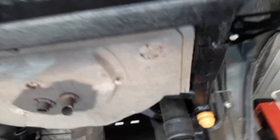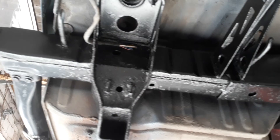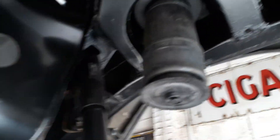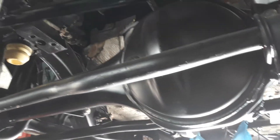The 50th - I've just put up a photo album of this but as you can see it's all coming on really nicely with quite descriptive pictures. New flexes throughout, new brackets, new shock absorbers, new suspension airbags, new bump stops. The chassis has been done all the way from the back, along the chassis, all the way up to the front - pretty much a complete job. New flexes again at the front, new calipers, discs, pads, shock absorbers, airbags. This axle the customer actually sourced from Italy because the front one was not in particularly good condition. New bump stoppers again on the front, so that's coming on well. There's the gearbox all cleaned up as well.